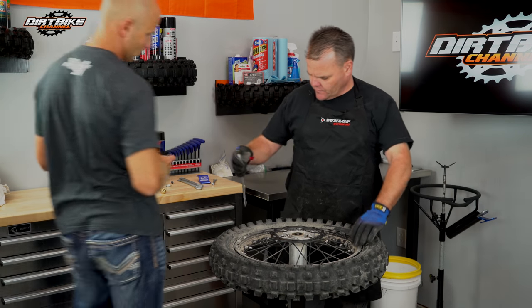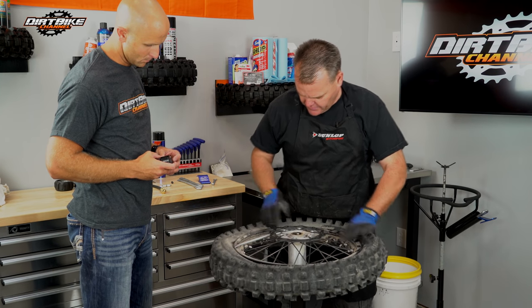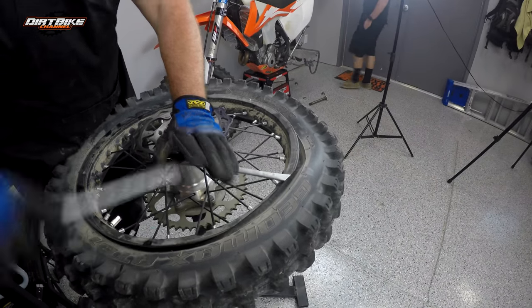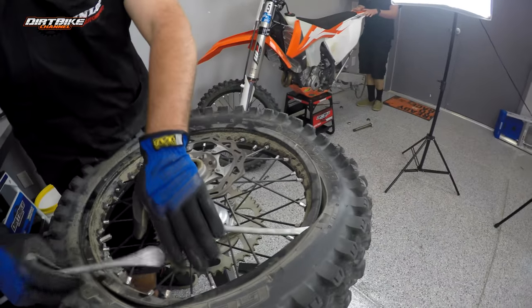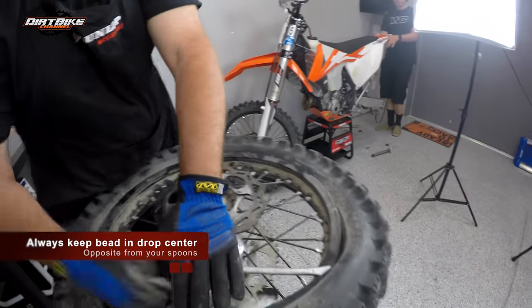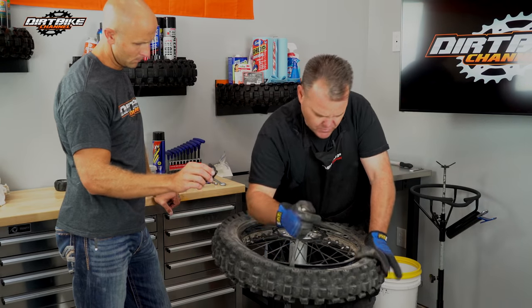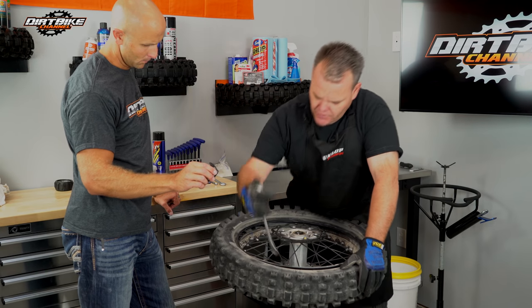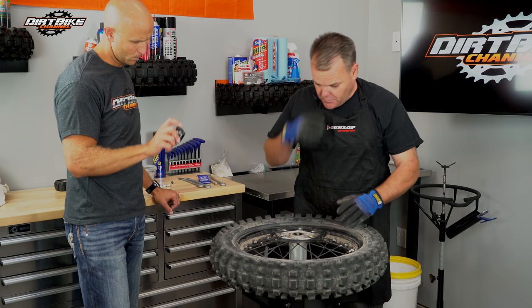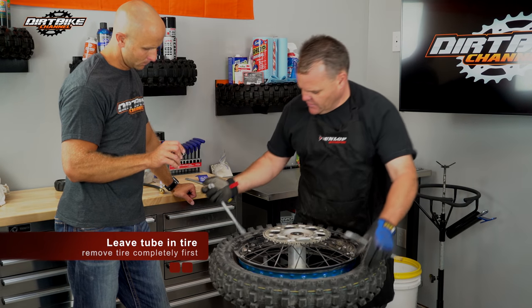Now at this point, I start about eight inches away, get the tire spoon in there, pull it towards me, and lock it under the disc — disc up from my first side, so I start with the sprocket up on the other side. I just pull that spoon out and keep going. If it starts getting a little tight, push down on the bead on your opposite side — you want to keep it down in the drop center. I work my way around until I'm down to just one spoon, with my left hand keeping down on the tire.